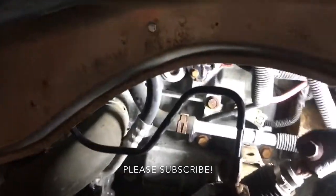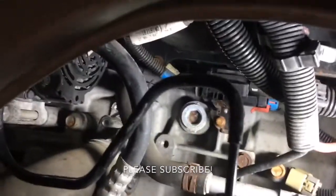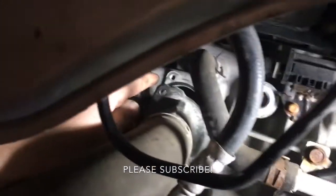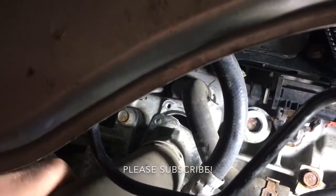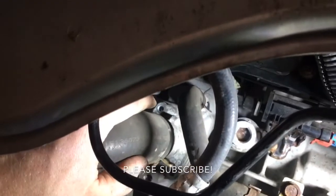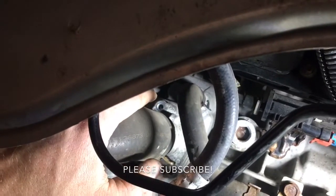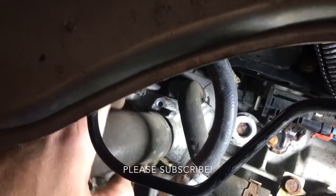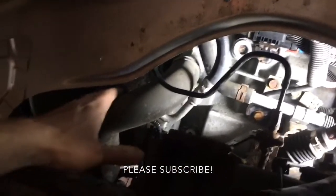Once all that's drained, you're going to come back through this wheel well. The thermostat is under the alternator — it's right here, and you can see this is already loose. There are two 10mm bolts: one where my finger is and one where my thumb is. I got in there with a long extension and they came right out.